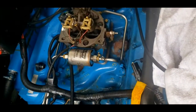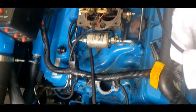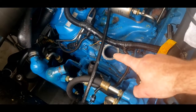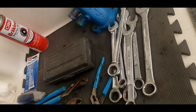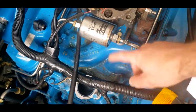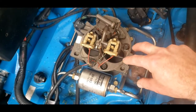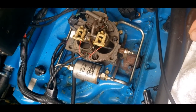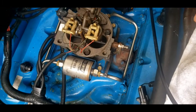So this is what we're working with here. If you remember from my last video for this boat, this is the blown out gasket here. To get this off, the distributor needs to come out, coil needs to come out. Some other things have already been done — the port where the thermostat housing goes, that's already been taken off. And then all the intake bolts need to come out. We're going to leave the throttle body injection unit on the manifold and pull the whole thing up as one assembly. That way we can get underneath there, get a good inspection, and see if we can spot what caused the gasket to blow out — or maybe it was just a bad gasket, who knows.